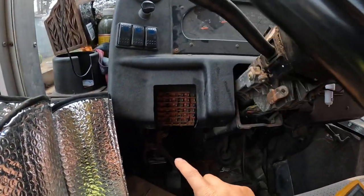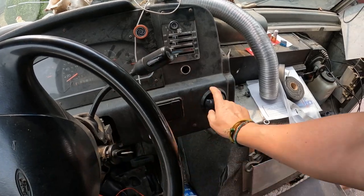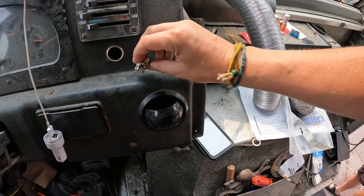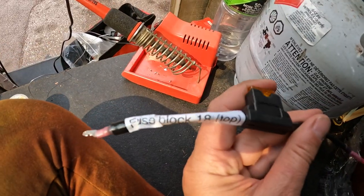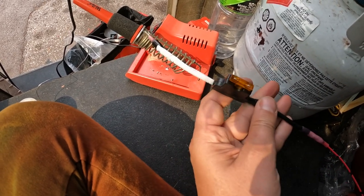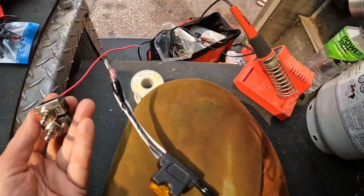What we're doing next, we are connecting the switches to a port in here that is unused, which will become active when the ignition is on, and we're going to put these very cute switches on the dash here. Wouldn't that look great? First, if I mix it up, there we go, fixed. To help out future me, I've labeled the wire. It plugs into the fuse block, and we have a little fuse that runs in here. Then we'll connect it to these switches.